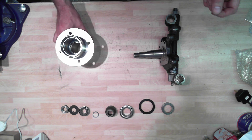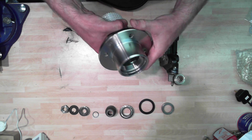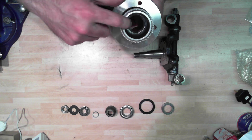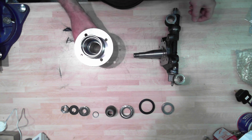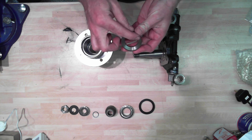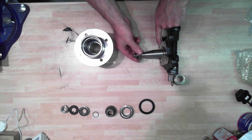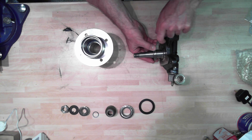So here's the trial assembly. This time I've inserted these two inserts in here - you can see one there and one down the hole there. So the first thing that we're going to do is put this collar, bevel edge side down the shaft onto here. There's the bevel that's going to take up that radius there.